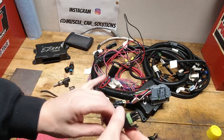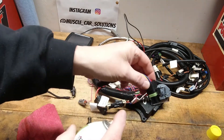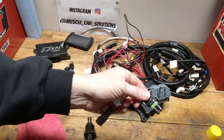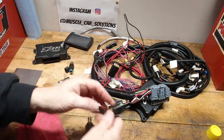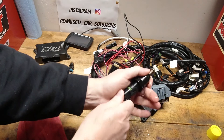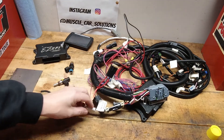I'm going to show you here on this connection on this idle air control valve — if you spray that on there, it is a lot of spray that goes on there. Make sure you wipe it on the seal very good and then wipe off all the excess, and you will have no problem with this thing sliding back together and making a good positive seal, and getting the seal seated into where it needs to go to make sure that water and dirt stays out of the connector.